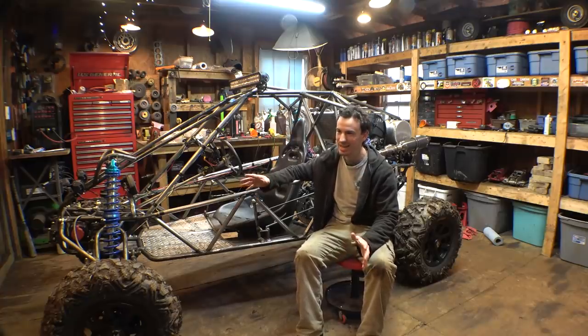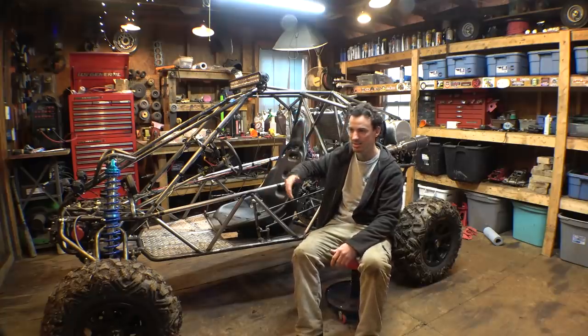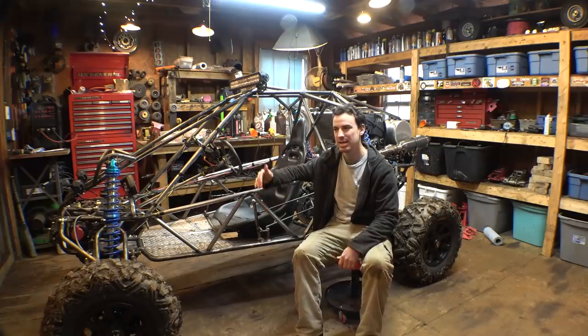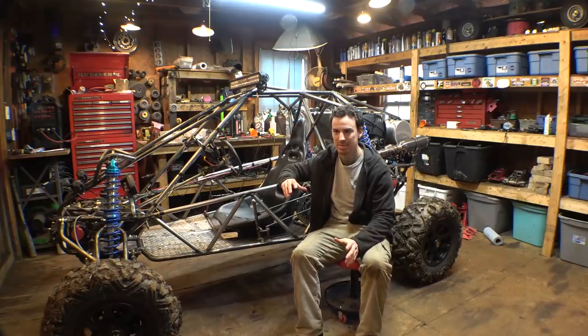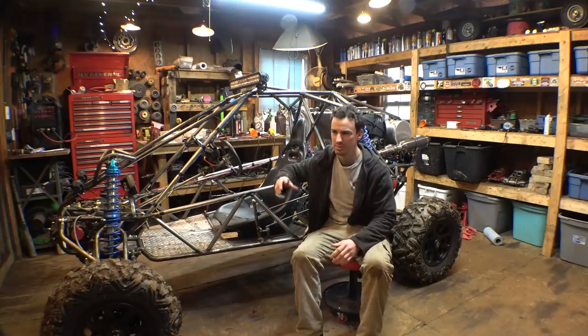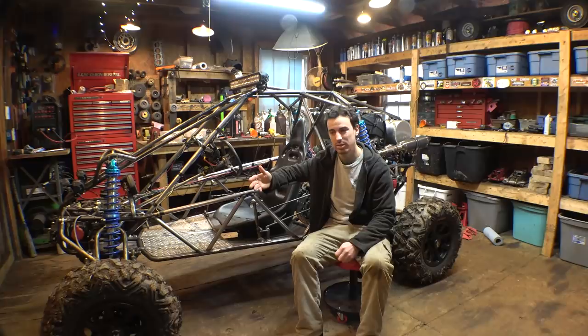So I'm panicking, thinking, crap, do I have a bad gasket somewhere? Is the head gasket good? Didn't end up going yesterday, and ended up staying here doing a bunch of tests. I drained the oil. The oil was a little bit milky white, but I think it was just from the previous time it had water in it, because I know you guys were saying it needs like 5 or 6 flushes of oil to get that moisture out of there. And the oil didn't look like it had any fresh coolant in it. Also, I'm using red coolant, and it didn't have a reddish tint to it.